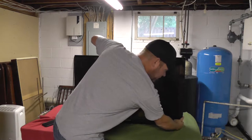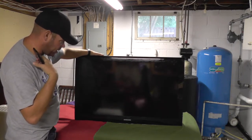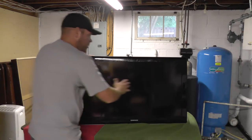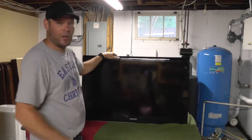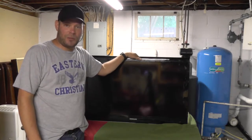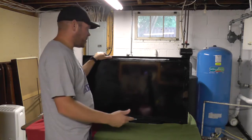I plugged this one in just to show you what's going on. This is the 40-inch TV I'm actually going to pull apart. You get the chimes when it turns on — always good. You'll see the backlight doesn't come on. The LCD is cracked. If I turn the lights off in the room I can see something going on, but the picture is not across the whole thing, so I know the panel won't work. I know the T-Con board works, the power supply works because we're getting chimes, and my guess is the main board works too. I can use all the parts in here for something else.